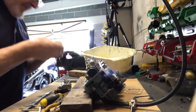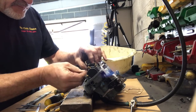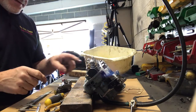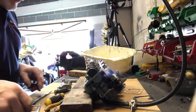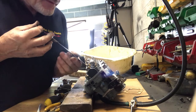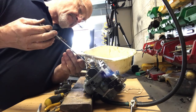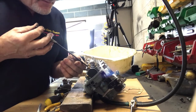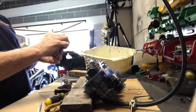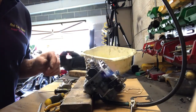I'm going to do this one a bit more because it had a bit more to go. Screwdriver on either side, ease it down gently. I always think I've done it too much and then find I haven't done enough. Just make sure it's just resting on the top — you can see the sprung nature of the needle valve there. This one was very high so I need more adjustment. That's now sitting at 28, and it was at 26 before — so I think that's gained us sufficient. Let me just pop these needle valves on and we'll have a look at them together.